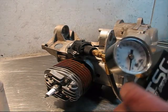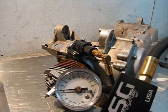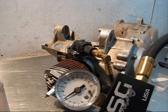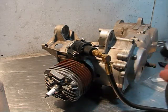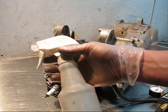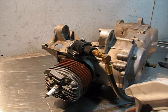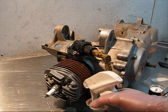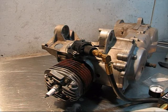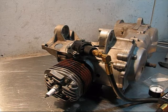This engine has an air leak. We pump it back up and you can see it dropping rather quickly. This engine, if we were going to run it, would probably not last long. What we need to do is discover where the air leak is. To do that, use a spray bottle with soapy water in it and spray it on places where the engine is very likely to be leaking — around the spark plug hole, around where the head gasket is, the base gasket. Keep in mind the whole time you're doing this, you want the engine to still have pressure remaining inside of it, otherwise you won't be able to see any bubbles when you find the leak.